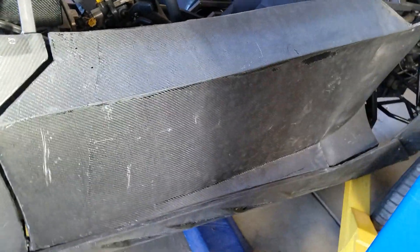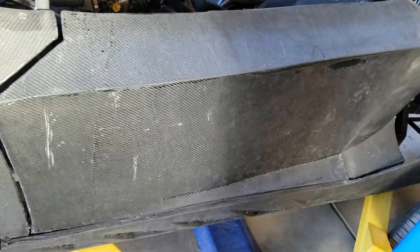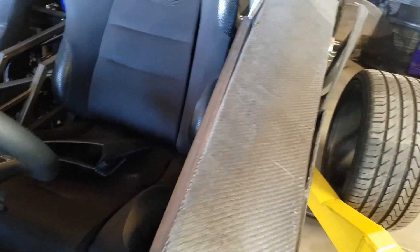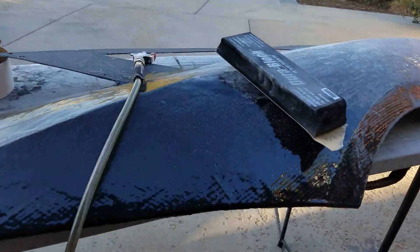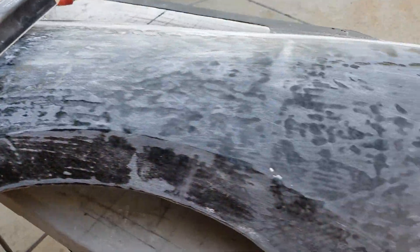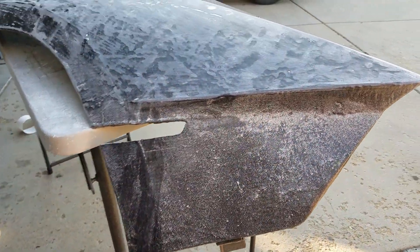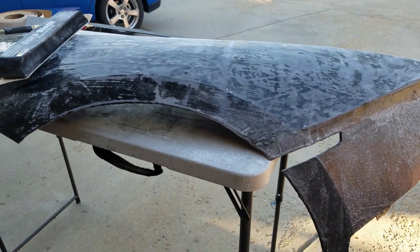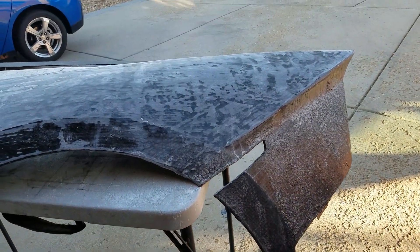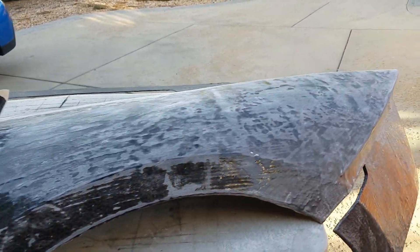Things like the doors and the rear quarters came out — I wouldn't say perfect, but they don't have any distortions in them. As we saw in an earlier video, I'm going to be redoing these scoops right here. I've started printing out the scoop bases and I've made sure we stay to our five millimeter thickness with a fast honeycomb. That's what the rear quarters were printed with, and also the doors — and that's why the doors actually don't have any distortions. I'll do a next video showing the next layer and sand-down, and hopefully you'll see the progression of this getting a lot smoother and the body lines really starting to pop out of the carbon fiber.